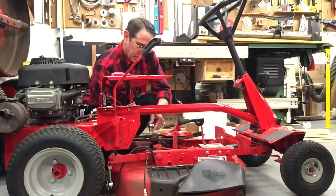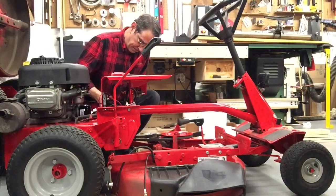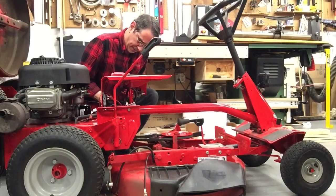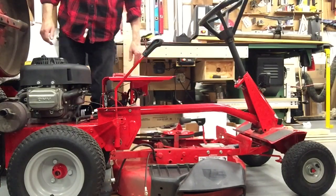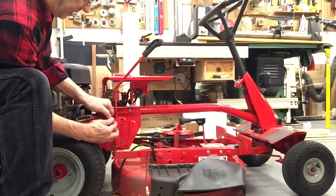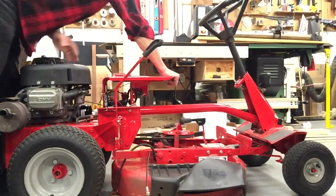I would put in a carriage bolt from the bottom, so you don't have a bolt hanging down, because if you do, it's probably going to collect debris on the parts sticking down, and you don't really want that. I'll hang these chains up in here. And then we can get to the wires. And again, for the idler pulley on the belt, that is a 9/16 nut and bolt. Now we can lift this up a little bit and get it off the floor.